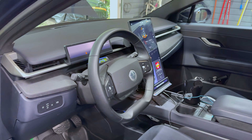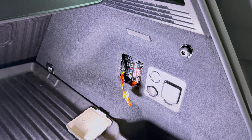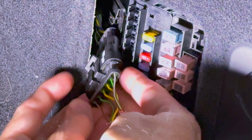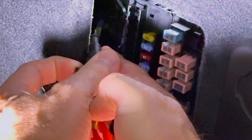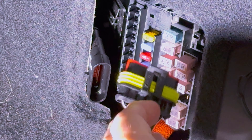All right, it has been over 30 minutes and it is no longer in ready mode. So I am going to disconnect the fireman switch back here. There's a little clip right here that you pull up on, and then this detaches. Pull on that and then pull it off — it is now detached. I'm going to place that aside.